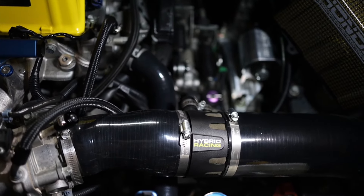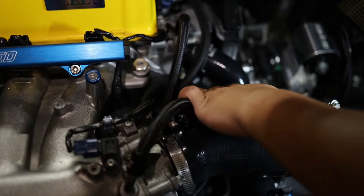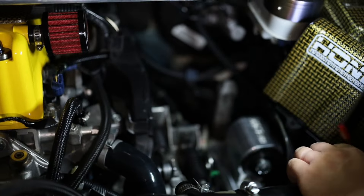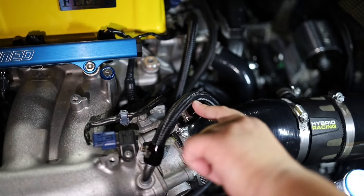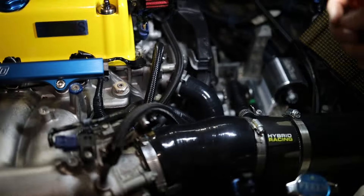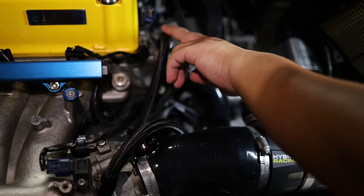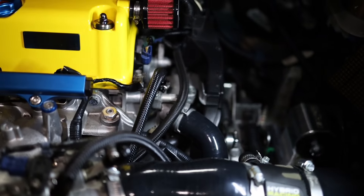So here's a recap of what we did today. I deleted some old OEM wires from the evap, from the brake booster, to connect to the firewall. So I got these braided lines — this is my brake booster — and I rerouted it, went underneath the intake, around to the battery, next to the motor mount, all the way back to the firewall. Then for my evap, I actually disabled it from Hondata years ago. I just finally had the time to take it out. I just capped this end and capped that end. It looks so much cleaner. There was also a radiator fluid line going into my throttle body. What I did was I used the braided lines and cut the hoses from here — so you can see, from here it goes into the motor, into the throttle body, and it just loops right down. So much cleaner, so simple.